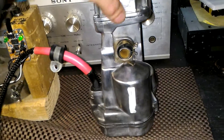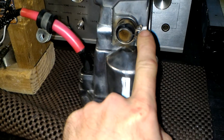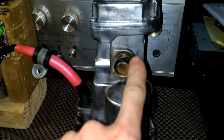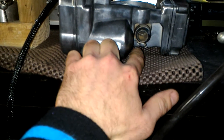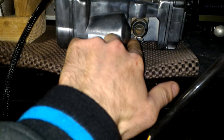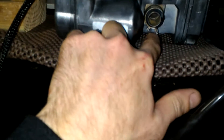I left this piece here. The reason why I did so is that when you put new pipe, orient these little pieces downwards. Because if you're going to orient them upwards — or sideways rather — this is down. This is how the throttle body sits on your intake. So you have to leave these down, same exact way as this one. Because if you're going to have them sideways, there is an intake runner that runs over here. So these little lips here, they're going to hit it and not be able to put the throttle body really flat — you're going to start bending these things. So you've got to make sure that these things are oriented downwards.